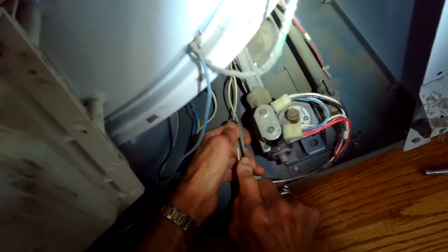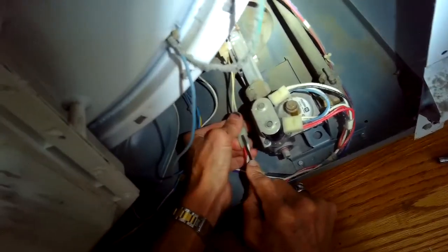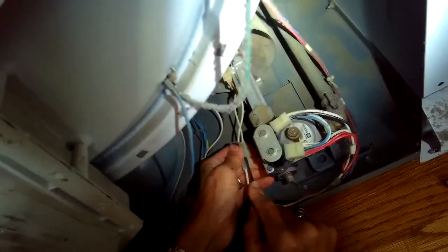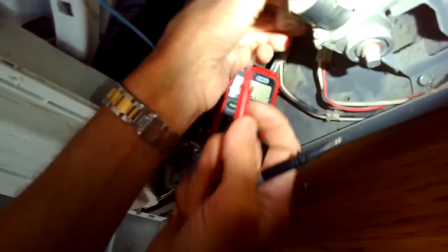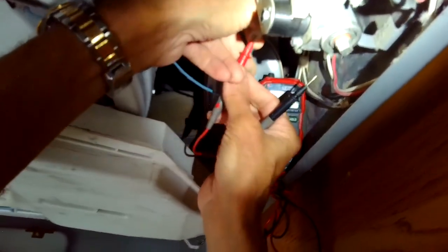So I know it's either going to be a faulty igniter or bad gas coils, and usually it's the igniter. I'm going to test that by separating the modular connector with a small standard-head screwdriver — pry that apart — and then I'll put my continuity tester on the two terminals of the igniter. Set it for continuity; it gives me an auditory beep if the electrons can flow through it. I'll put one probe on each of these little terminals.